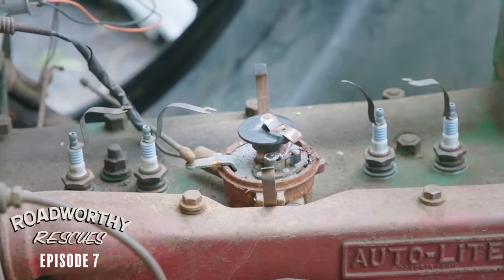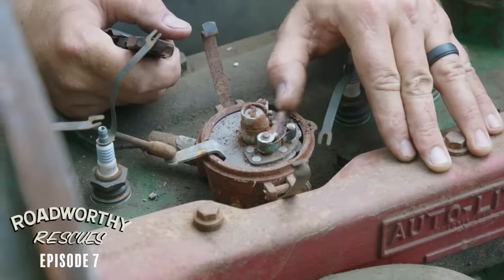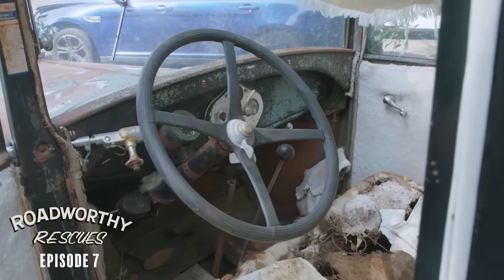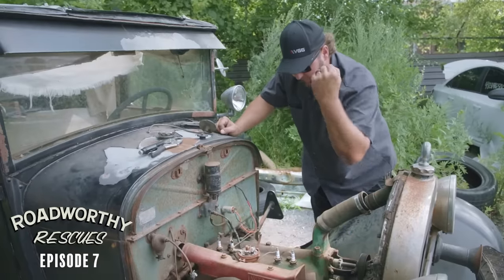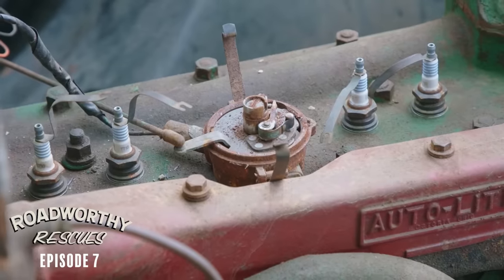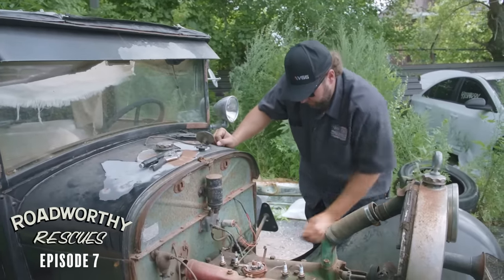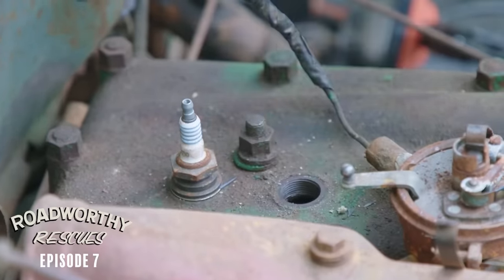The good news is that's been full of water. Points are severely corroded. The timing and throttle controls are actually on the column, and each click you can add timing. Pull and hill, stuff like that. Otherwise fuel efficiency, performance - you can throw some timing in the thing and scoot around a little bit. I think I'm gonna pull the spark plugs out.